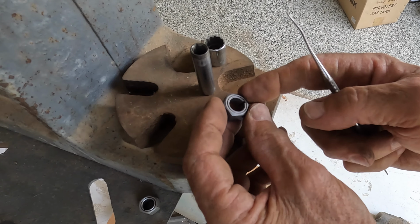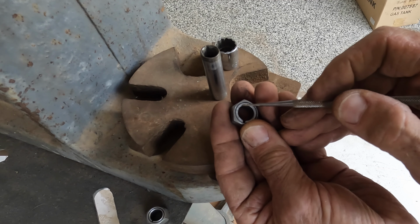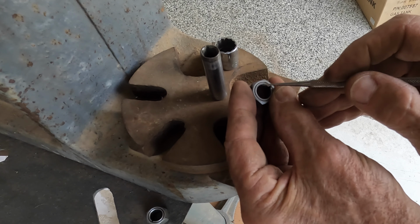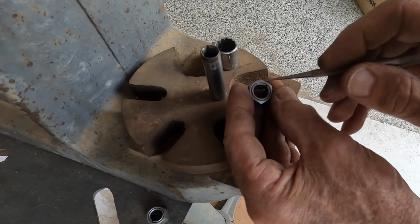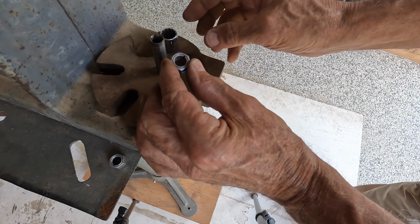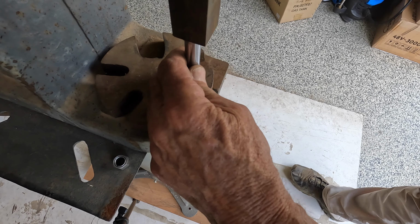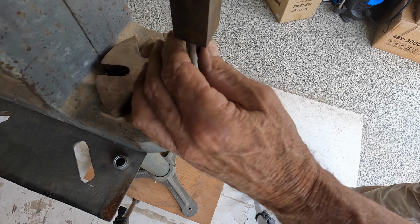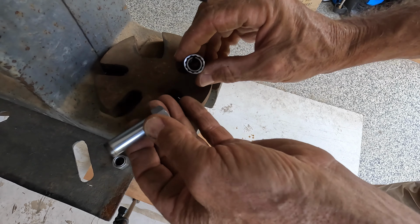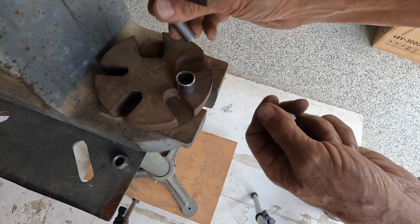Alright, so now this is another sort of a reenactment. I've soaked these and they're kind of clean, but you'll see that there's a large cross section on one side of that ferrule and then a smaller cross section on the other side, and the smaller side is the tapered side, so you want to push it out the opposite direction towards the wide side. So here I just did a stack up, used the socket below and a socket above to just give it a little push with the press, and they come apart. And there you go. There's your two pieces.